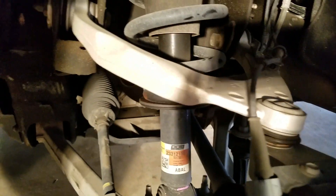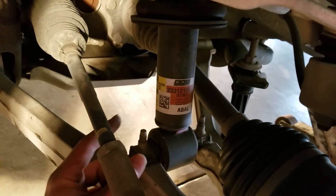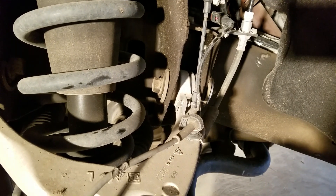That's how it's originally set up. The two bolts we need to take off will be this one here and the one on the other side. Once we unscrew those, the little metal shim — the one and a half inch spacer — goes right in between them. We'll get that set up and I'll show you how that looks in a second.